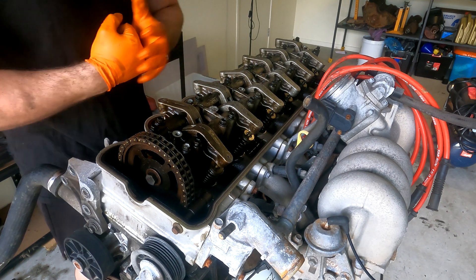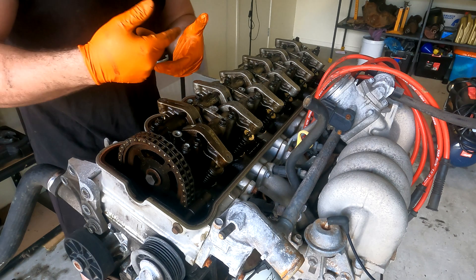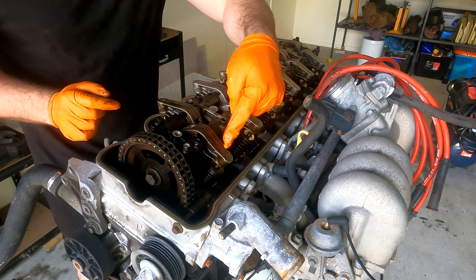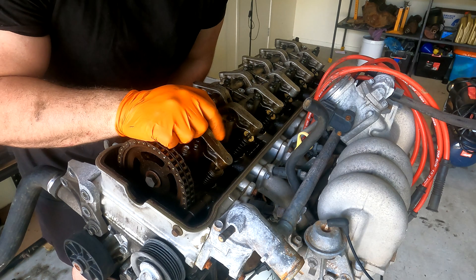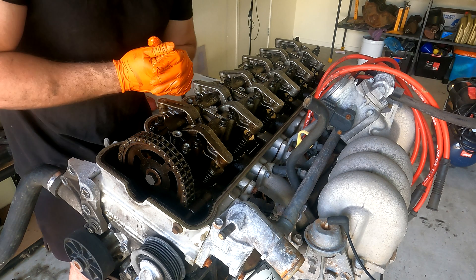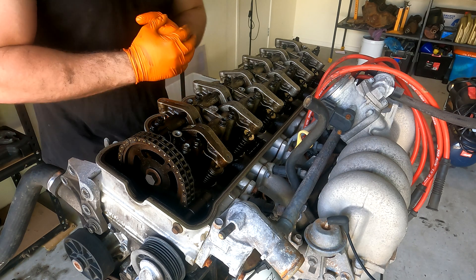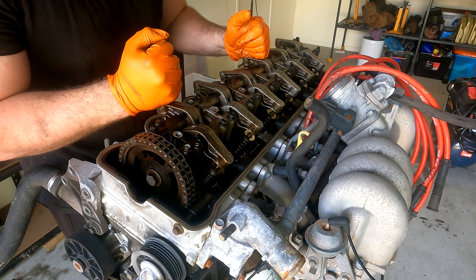If you have one of these, you've got your cam gear at the front here - this is driven by the crank, which rotates the camshaft sitting longitudinally in here. As the camshaft rolls, the lobes press on these rollers, which push the tip of the rocker arm down onto your valve. Valve spring, valve tip - that's what opens your valve. These rockers are known for not being that strong, but if you don't have problems with valve control and you're not bouncing the valve causing trouble, we can probably make these live. A lot of people might argue you can cryotreat aluminium - some say it doesn't change the crystalline structure. I'll leave that up to you to decide. Tunnel Vision do sell billet rockers, but if we can stay away from spending big dollars on rocker arms I'll be happy. We'll try and get these to work.